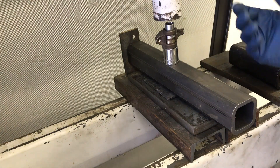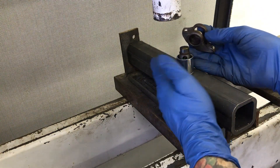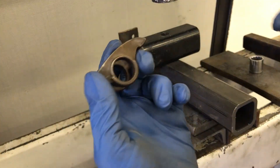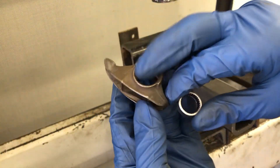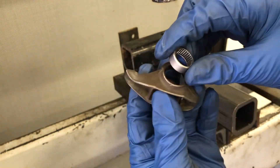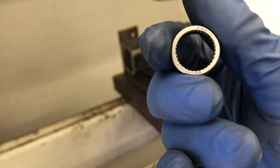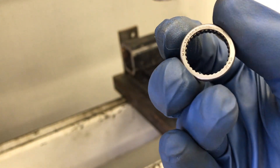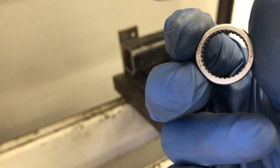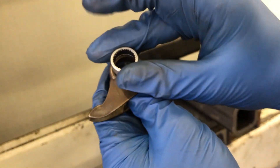Once that falls through, it's out of there. There's all the needle bearings. So step one is to install the bearing on the upper side — not the one that's got the ears, that'll stay on the bottom. So the top side is where you install the bearing. One side of these bearings has writing on it and the other side does not. It's really important that you install the bearing with the writing facing outward, just like that.